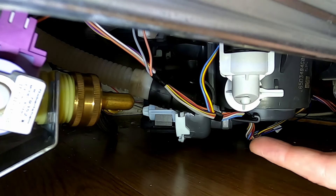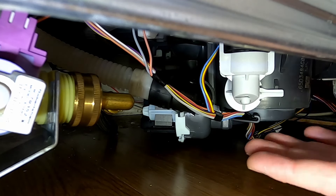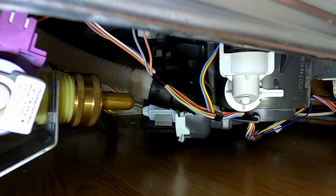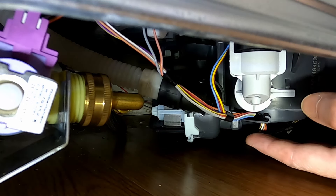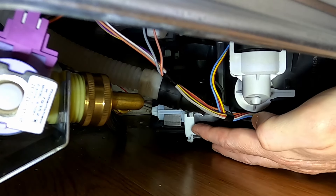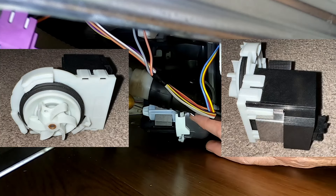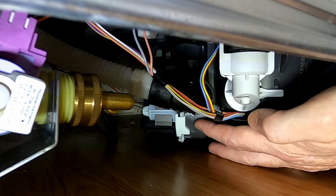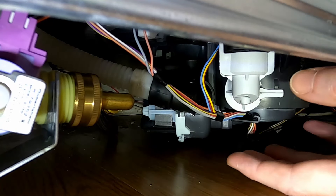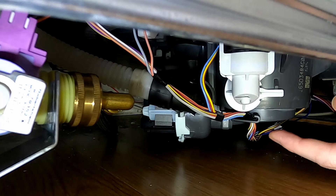So I just put it back in and everything worked. Something in my drain pump was stuck and I knocked it loose. It has worked since — it's only been a few days. If I do start getting that failure to drain error again, it'll probably need a new drain pump. There's an impeller in here — while you have it out, check that the impeller is turning and not mangled from food particles.